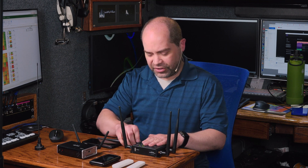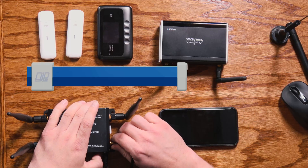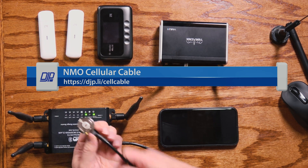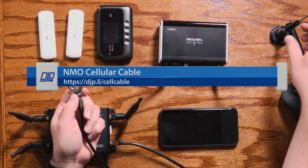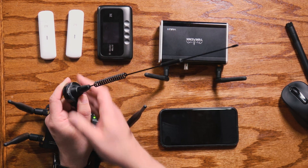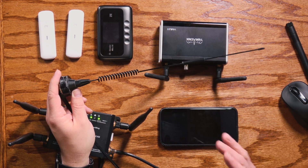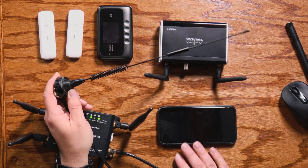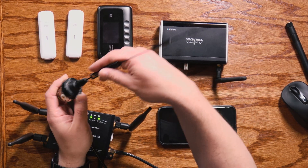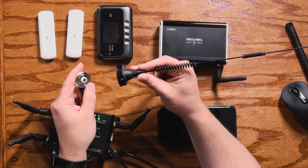You can also hook up external antennas. If I wanted to use an antenna on the roof, I can disconnect one of these side antennas, grab a cable like this one, and plug it in. Then on the other end on the roof, you have a connector called an NMO, and you just take an antenna like this one and pop it on there. This gives way better coverage than a built-in cell phone antenna — it's much bigger so it captures more signal, and it's tuned specifically for cellular, whereas cell phones have to compromise on antenna design to fit inside the phone.